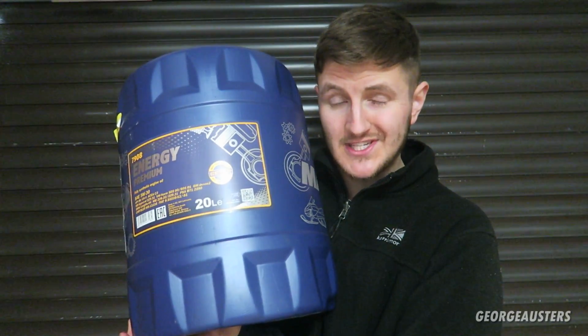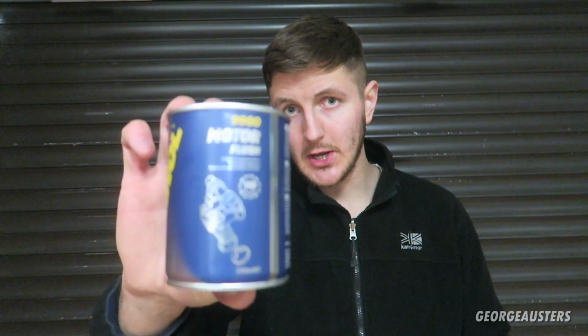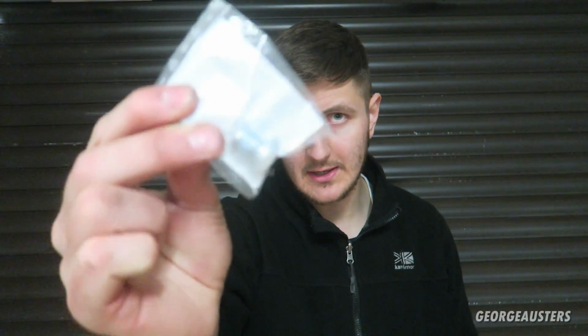Now then, in this video I'm going to be doing an oil and filter change, also an oil flush on my BMW M47 engine. This process is going to be the exact same for the M57 engine as well. My engine oil of choice is this Manol 5W30 LL04. The oil filter we're going to be using is a Bosch one, and the engine flush we're going to be using is this Manol 9900. And we also have a new sump plug to go in as well.